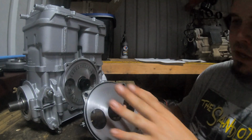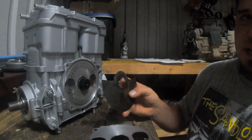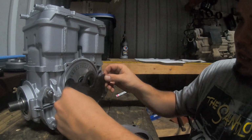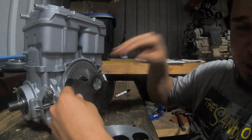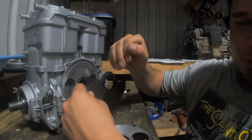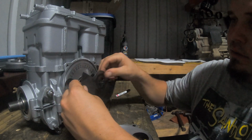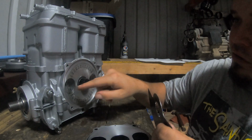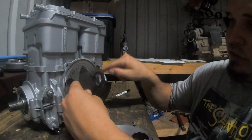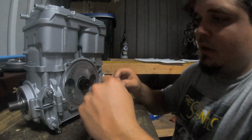So this is the rotary cover plate. This sits on there like this, and this rotary valve, it's actually timed. What this does, it rotates, and these openings, so the carburetor is always sucking in, vacuum's always been pulled through that carburetor, always sucking in air and gas. As it rotates, this is opening and closing each port for the cylinders, and that's actually timing it to allow the air and fuel mixture to get within it.